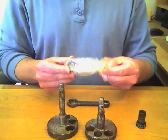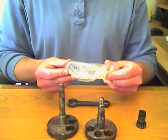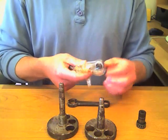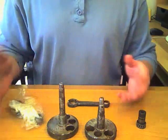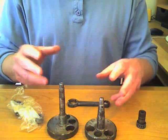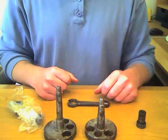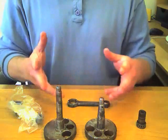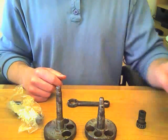This Rito rod is specifically for the Tomos. It's a complete kit with the connecting rod bearings, pin, and this one has a roller bearing instead of a bushing on the small end. The job will take a bit longer since I have to clean up all this rust, but I'm going to press the connecting rod in, true it up on the truing stand, and come back for a brief follow-up.